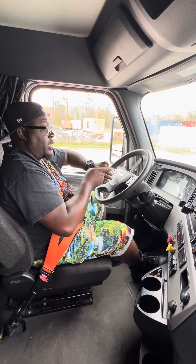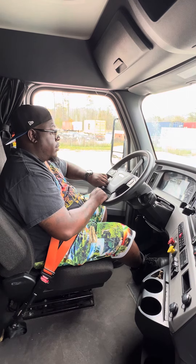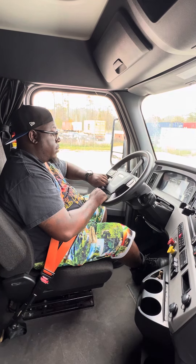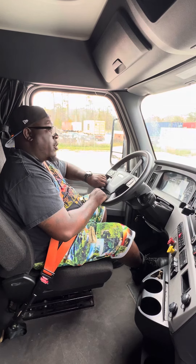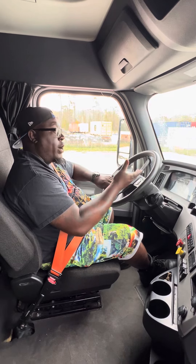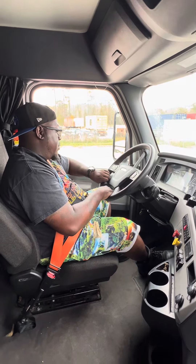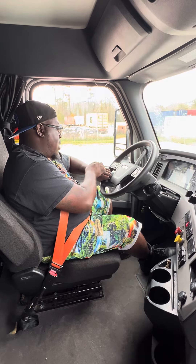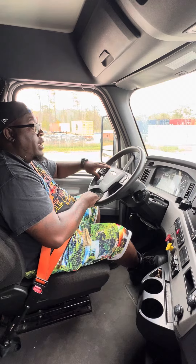Make sure you tell them that your air pressure was at 125 before you started the one minute. Keep your foot on the brake through the duration — all the way through saying where it's sitting after 60 seconds. 60 seconds is up. I didn't lose more than four psi within those 60 seconds. My air pressure is sitting at 122 on my primary and secondary air pressure gauge.